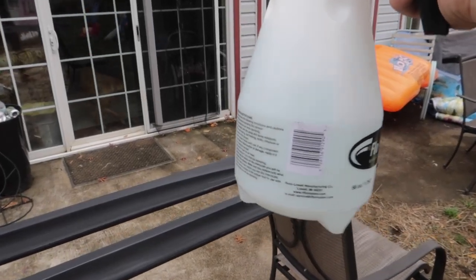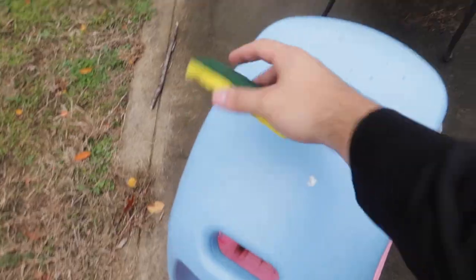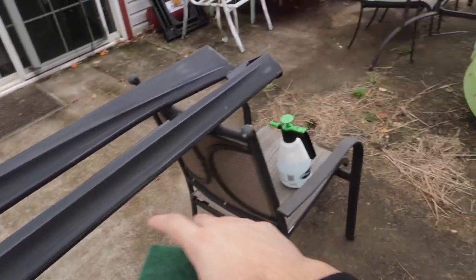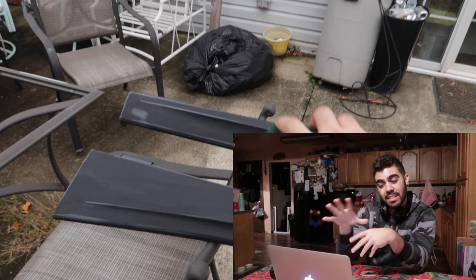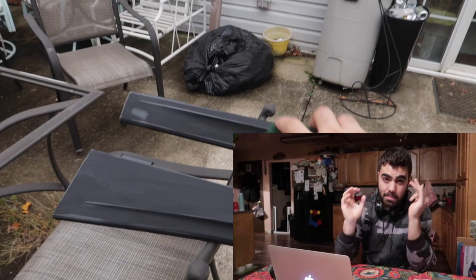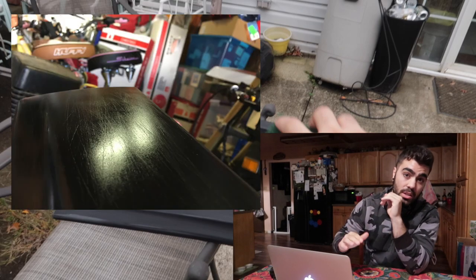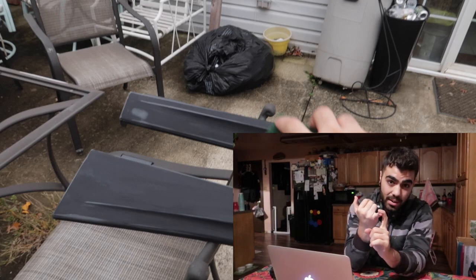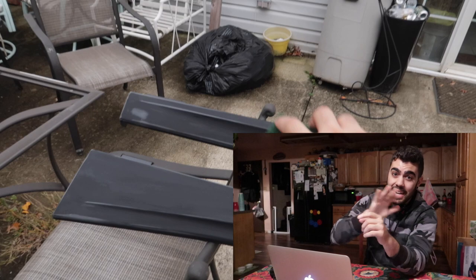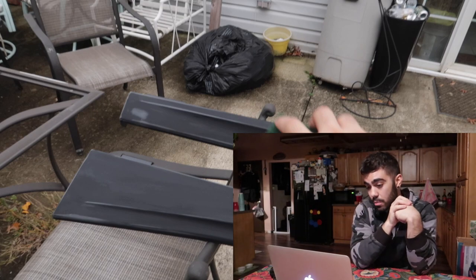So I have my soap and water solution. I have my two side skirts, and I'm going to use my dish sponge to give it the initial soap and water clean. Right here, you can actually see the state of the side skirts. So after I messed up and I sanded them and I painted them, I had to retrace my steps. So I wet sanded with 800, with 1000, with 1200, and it got it nice and smooth. And that's what they looked like afterwards.